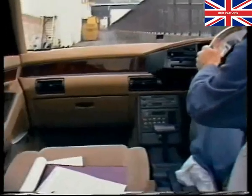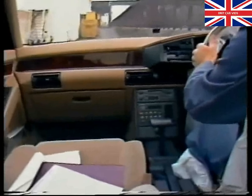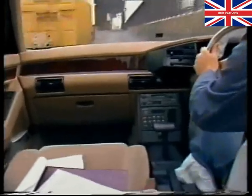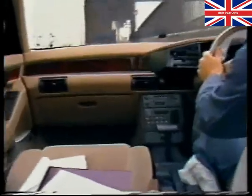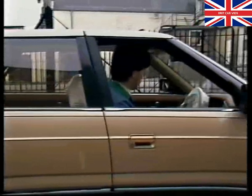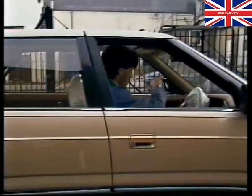Next, select D4 and apply light throttle. Note any slip or judder during gear changes. After these tests, mark on the report form whether the gear changes were acceptable or unacceptable. Then repeat the test with medium throttle.